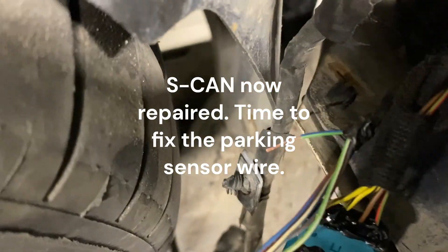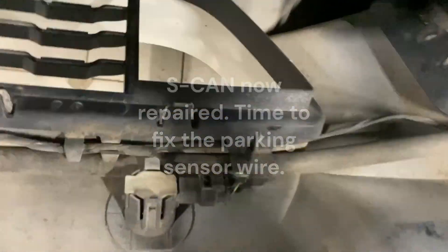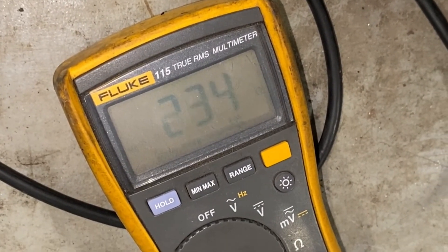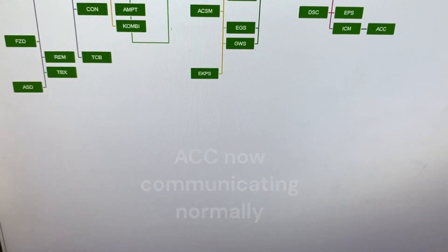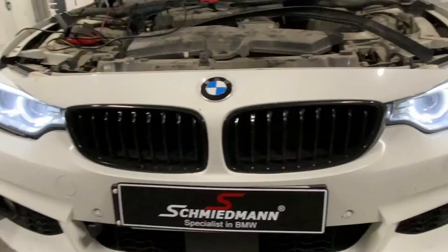Let's go back to the wiring. The center-left wire is blue-green — that's the one. I'm going to make a new wire from there because I'm not happy with it. I checked resistance — near zero — and made a new wire. There were no comms faults to ACC. As you can see: absolutely no faults. I'm really dead happy with that.